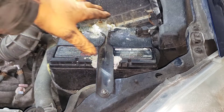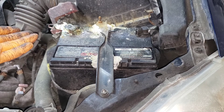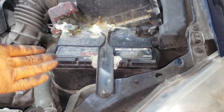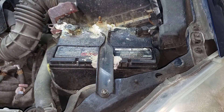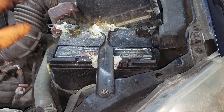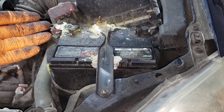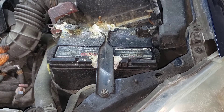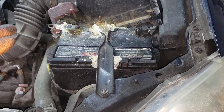What is all this here? It is basically hydrogen and acidic fumes that are coming out of the battery. It's reacting with the atmosphere causing this mushy stuff. The issue is specifically that you have a leak from the battery, so the gases are allowed to escape, and this is the situation that it causes.